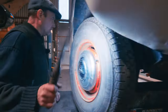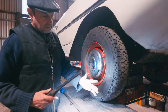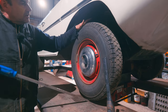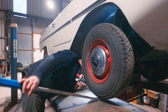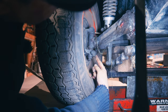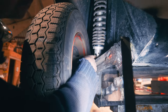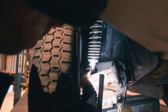I think with those wheel bearings like that it's given me a false reading. Until I get that wheel bearing tightened up I'm going to struggle to know quite what's going on. The idea of this was that we could lever up and down and see what other play we've got. But we've got so much movement in that wheel bearing. So if we look here, we've got play in the kingpins. We've got play in this knuckle as well here. We've also got play in this bush here. So we've definitely got a bit of wear in it.